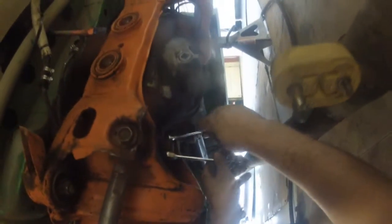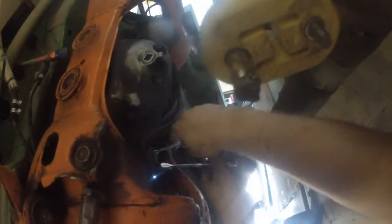Use the hammer just to break them loose, rotate the axle around, taking all the bolts out. Once all the bolts are removed, that's when you can start to pull the actual axle out. This is also the driver side, so I actually had to drop my exhaust down as well just to make some room.